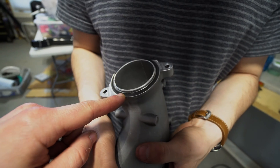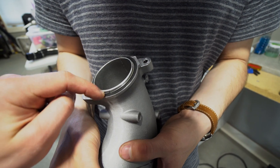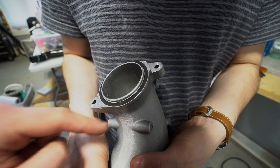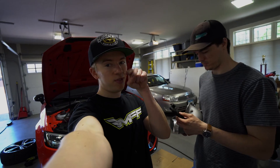One other thing to mention: this black gasket you need to reuse from the old inlet. When you install the inlet back onto the turbo, make sure it doesn't slip off — it looks like it has a little shoulder on there to retain it. We'll slip that back on, get this car back boosting down the road, and we'll see you next time.